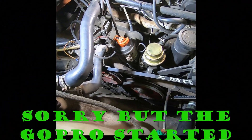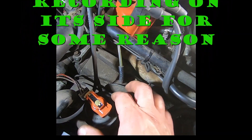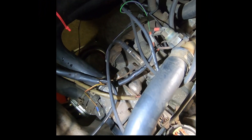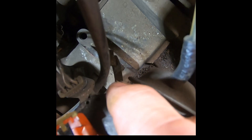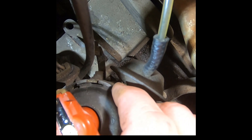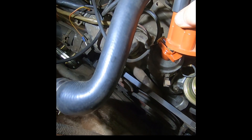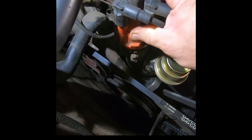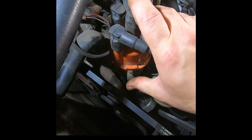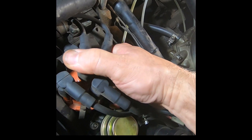What I like doing is just rotating it a few times, making sure there's no clunky noises and I haven't done anything daft. Next we need to put the distributor cap back on. You can see there is a little step there — that's got to go into that little lug on the distributor. That will just stop it moving. Wiggle the distributor cap back on — it's got a lug the same — so that's nice and secure, it won't rotate. And do the clips up, just push them up. That's on. Right, that's ready to start.